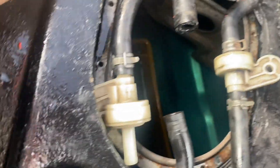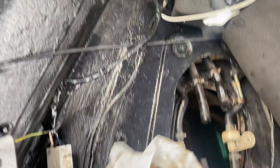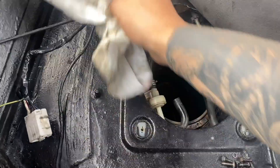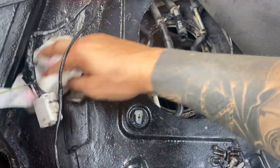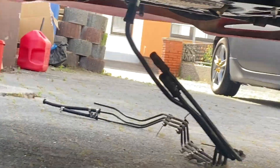Fuel pump is out. Oh, look at that — nice blue, nice pre-mix. I should have put a rag down or a towel. I knew it was going to happen. I spilled a little fuel when I pulled it out. There's the inside of the fuel tank — not too rusty, nothing crazy. Back when I was in Japan I ended up cleaning this thing out because it was super rusty, and I'm glad to see it's not really coming back. I finally got the OEM hard lines out — it wasn't too bad, super easy.